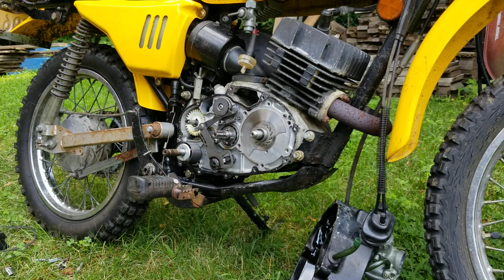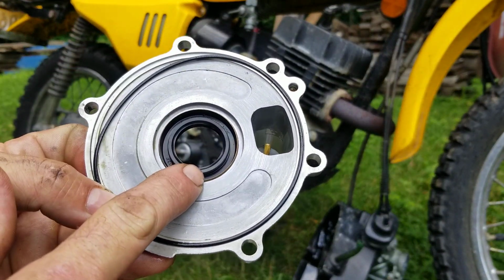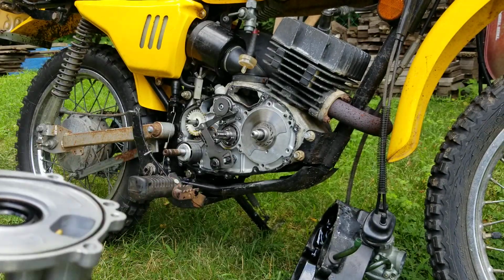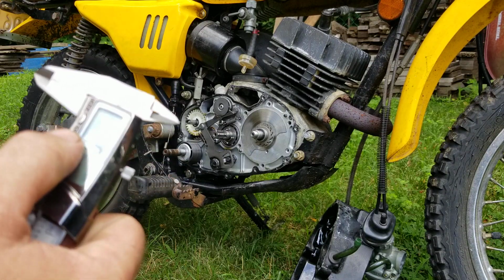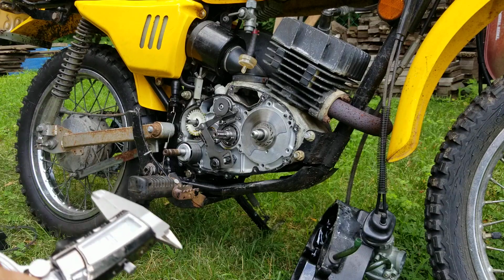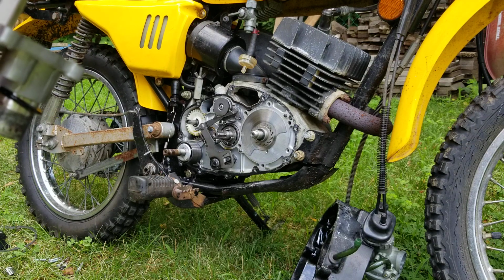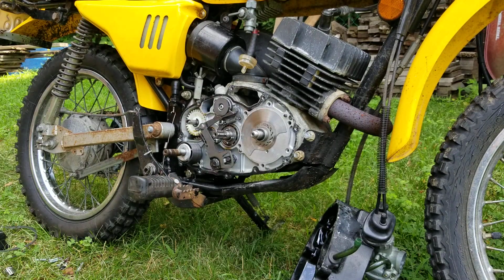Okay. So now we have another thing we can check, and that is the rotary housing. Now this has a depth. So this one's a little bit more complicated to check, but nevertheless, you can use the same piece here. You're going to put this on the end here without the seal, and you're going to check the depth. This part right here you have to be very, very meticulous about. And we're going to see what the book says.